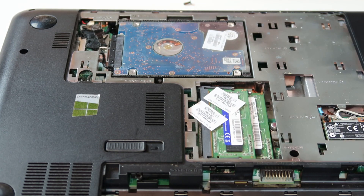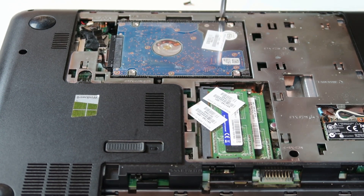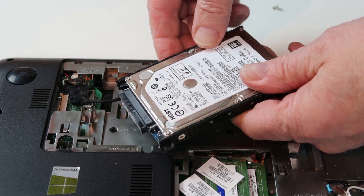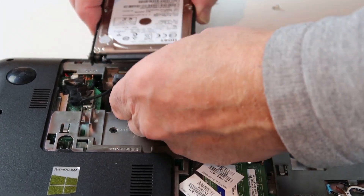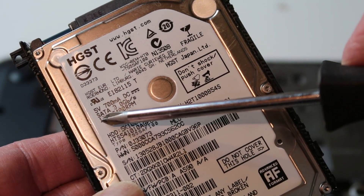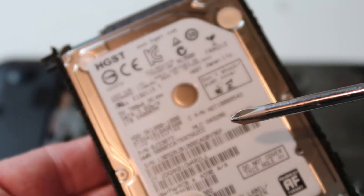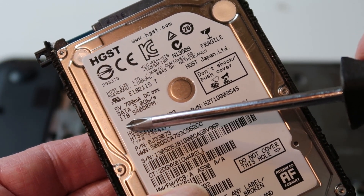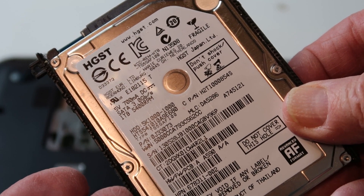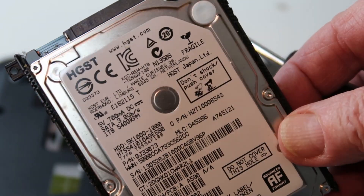Here you can see my RAM. Removing this is a pretty simple process — there's probably about four screws. Your hard drive is very likely in a harness of some sort, so you unscrew that harness and unplug the hard drive. As you look at the label, you see a lot of information. There's SATA — not sure how that's pronounced, I'm not an expert — but I do know that means this type of connection where it has a long bar and a short bar. This is a pretty good memory; it has a terabyte of memory on this particular hard drive. So I could completely erase this and just have that all as backup memory, or keep it as is with all the memory and everything I ever did on this computer.